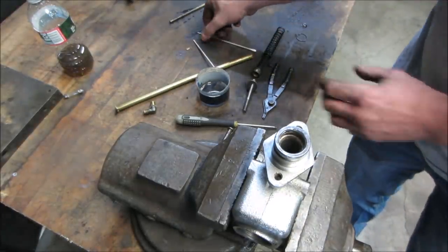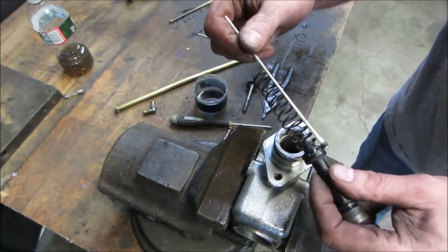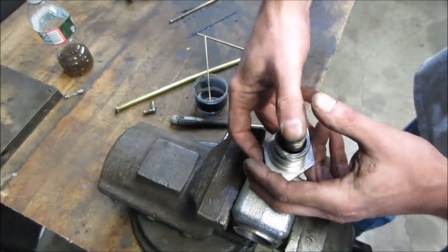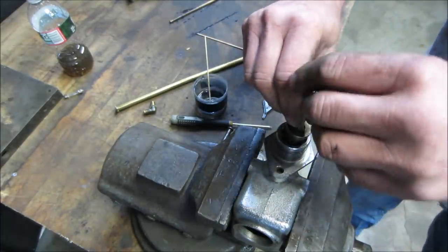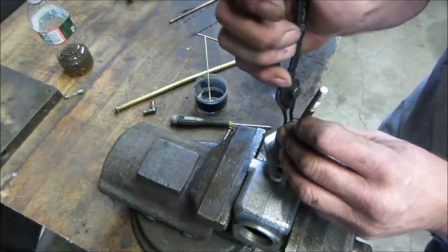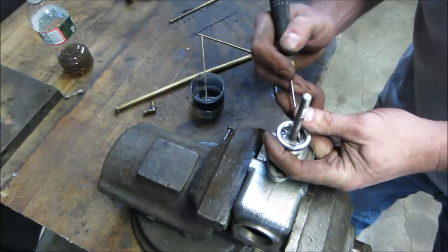All right, see if we can knock this out. I'm gonna take a Q-tip. I'm gonna lube this thing with some brake fluid. Let's give a little bit on the seals. And this should be able to go in and spring back for us, which it now does. We have that. We have the snap ring. It's got to go over it. And the pliers, see if we can get it all ready to go at the same time. There you get it. Kind of push around with a screwdriver a little just to make sure that snap ring is seated.